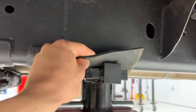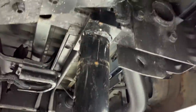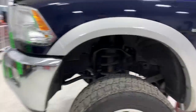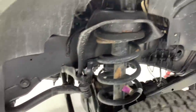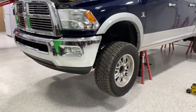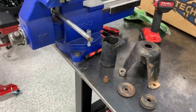The time lapse doesn't really do it justice — this thing had camber the whole way back. At least this time we had some rubber to stop the frame from sliding on the metal jack stands. In the back we just throw the stand as far back as we can up into that area on the frame. Now that's done, it's time to start tearing into the front — get the wheels and tires off, the bump stops, track bar, and small things. Tonight is Friday night so we'll hit it hard tomorrow.